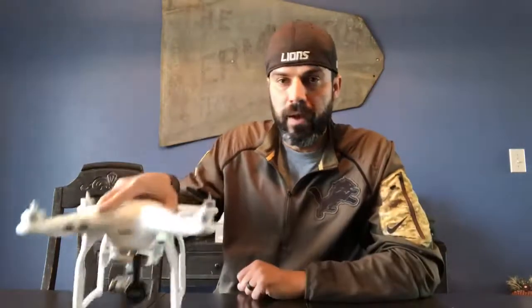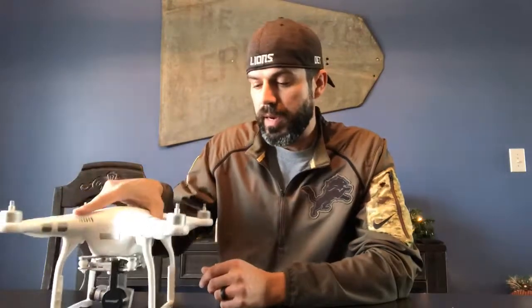So what I finally ended up doing — and it's super simple and it takes about five minutes — is just having to clean and check the connections on the bottom of your actual gimbal mount. I ended up losing about almost a year's worth of flying because I thought I was going to have to send it back or get a different one.